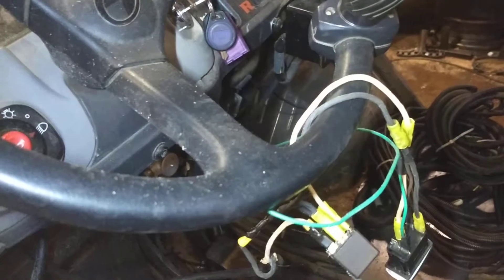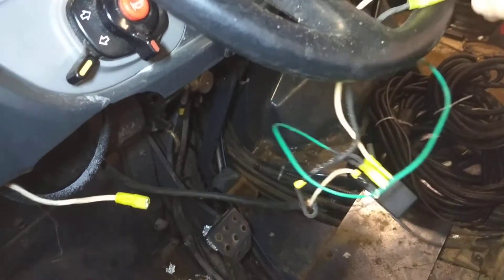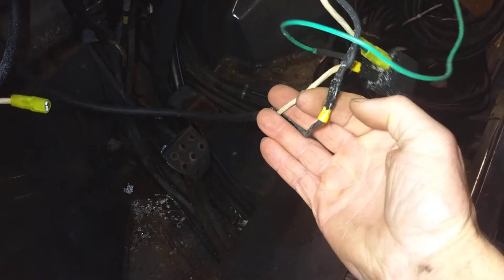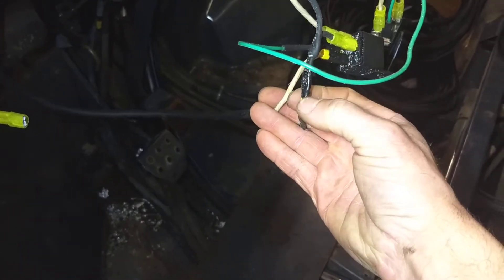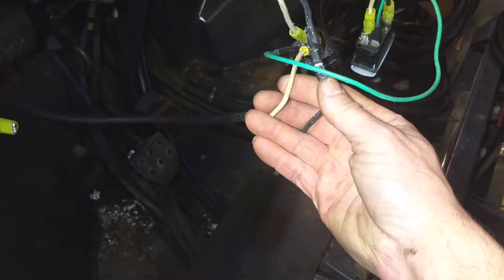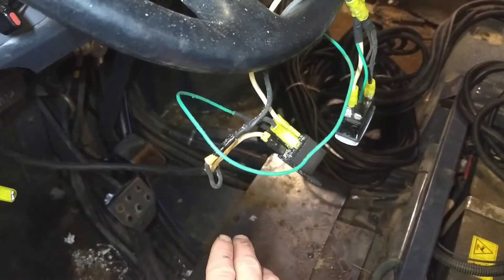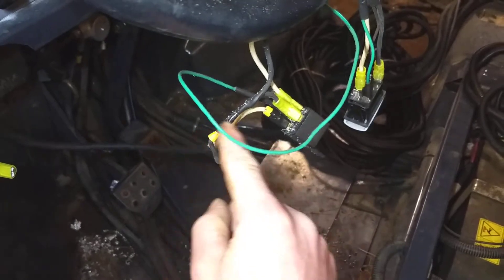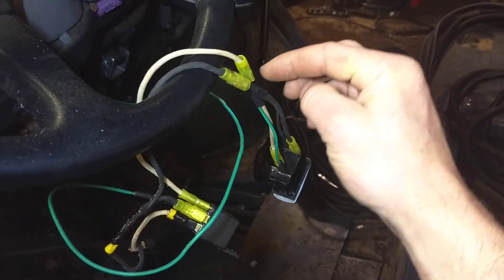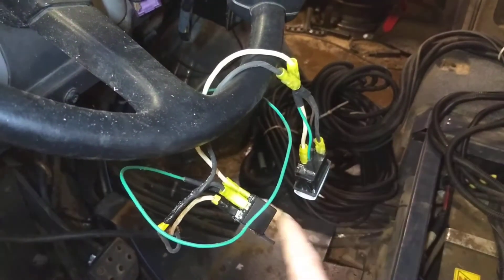As far as how this is wired in here, I've wired it the way I have so that it can be reconfigured if necessary. There are spade terminals, so your positive power coming in has these two spade terminals in the interior, which means you can disconnect all the switch and everything else if you need power at the front for some reason. I've also configured it so that you can disconnect power here and connect it directly, bypassing the relay that I put in, if you don't want the relay to work.